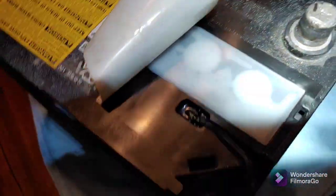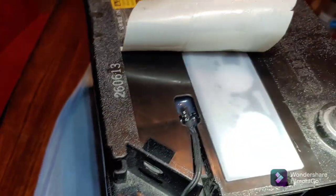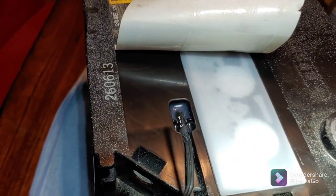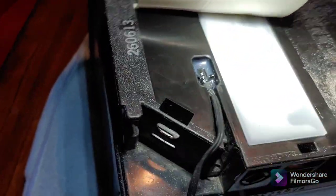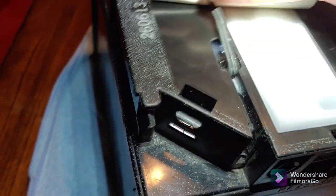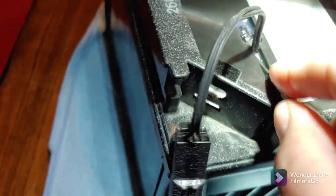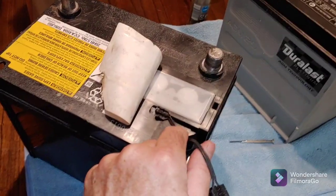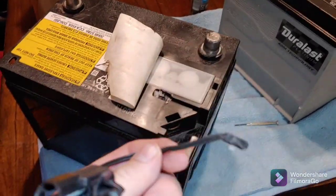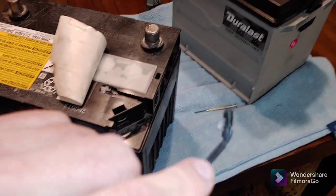You find there's a wire that goes in there and it's glued in. All you need to do is take that little wire out. If you get one of those little screwdrivers you'd use for eyeglasses, you can work that wire out of there with that. As we get that loose, what comes out is your little temperature sensor.